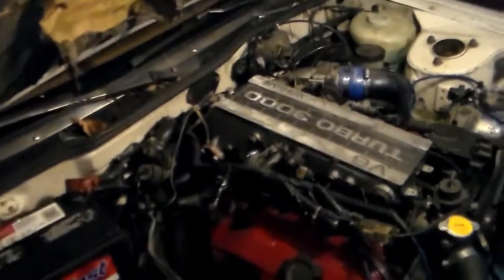We've got a little bit of damage on the wire here. I don't know where the air filter went, but here is some bad scorching. None of it was really behind the engine — it's all just in the lower intake area. So we might find some burned up wires or some random stuff as we get in there. But for now it's not too bad on the outside, so hopefully the injectors aren't shot and not too much is damaged.